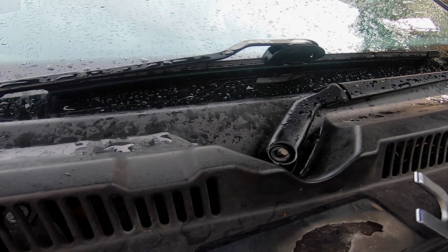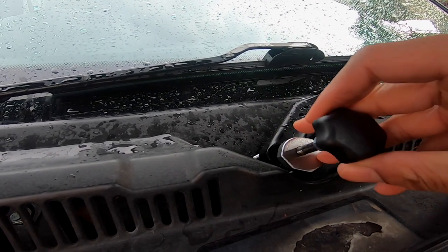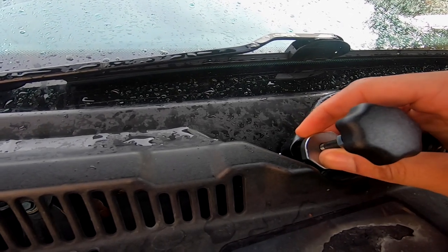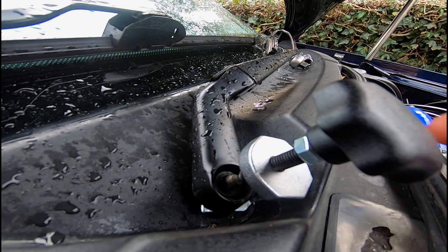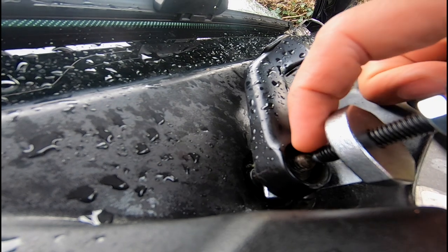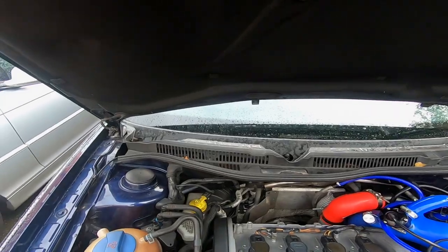Removing wiper arms is never really easy - normally you can pull them and give them a bit of a yank. I've actually had to pop out and buy this wiper arm pulling tool because I struggled so much. You literally set it up so that the two prong-type fingers go underneath the wiper arm, and this bolt piece lines up with that spindle and you just tighten it and it should pull it off. If you get this part slipping off the spindle, you can just put the nut back on a little bit and let it sit inside the nut. The arms are now off.